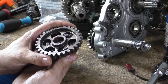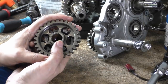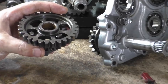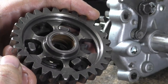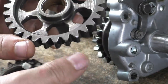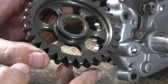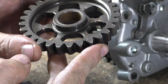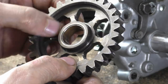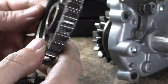And I know that's all confusing, and I'll do a really big comprehensive series of how gearboxes work. But basically this is upside down, but can you see those shiny polished edges that have gone a bit thin and all work hardened? You see them there, look. That's not the end of the world at all. But if I can get these cheap enough, I think it's worth talking to the owner of this engine to get that replaced. I'm worried about it cracking, because some of them are really... that one there. That one's a real mess in there.